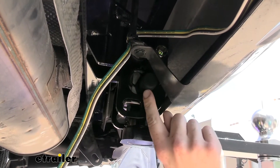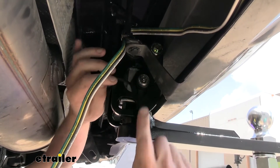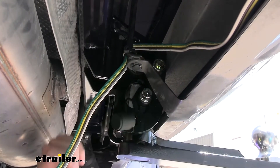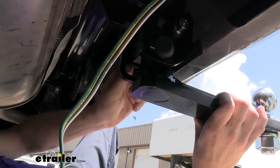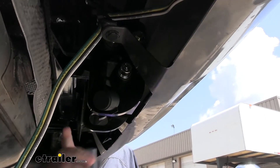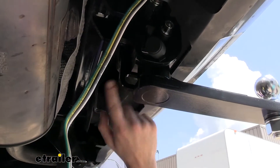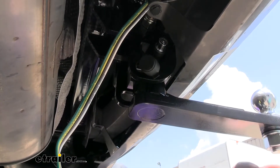We're now going to head underneath here so we can show you how the mechanism works. Here you can see this is the dust boot for the lock mechanism, so we're going to go ahead and pull that off of there — and there's our lock. You'll receive two keys with your kit to unlock it, so we're simply going to take one of those and unlock it. Once we have it unlocked, there is a twist handle on the opposite side — we're just going to give that a twist, and you can see as we twisted it, it just drops out of there. It also locks itself in that released position, which is great because now installing something is as easy as just pushing it straight up, and then it clicks itself right back into that position that holds it into place. We always want to make sure we push our lock tab back in before we go to use this.